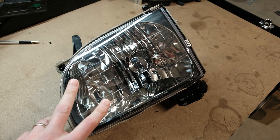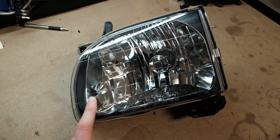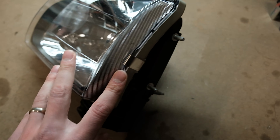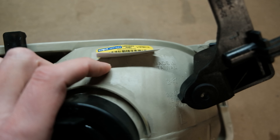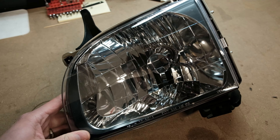The next thing we'll want to do is strip down our headlight. I opted to buy brand-new headlights because mine are pretty brittle on the plastic, as well as pretty hazy. They've already been fixed once, so I figured if I was going to go through this process, I'd just go ahead and pick up new headlights and start fresh. That involves taking off the clips on the sides of the headlight, and then you'll also want to remove the rubber and a bulb if you happen to have one in there. You'll also want to take off any paper stickers so they don't burn in the oven.